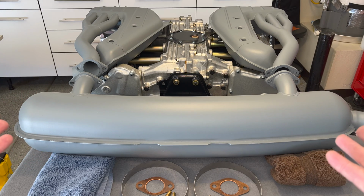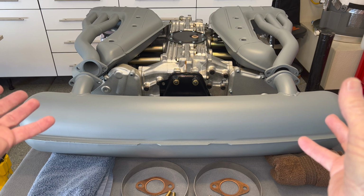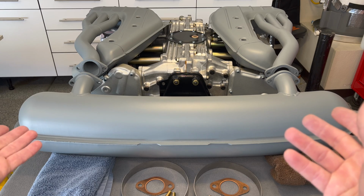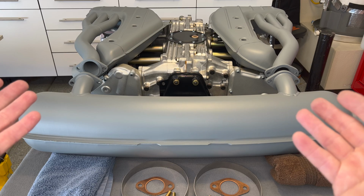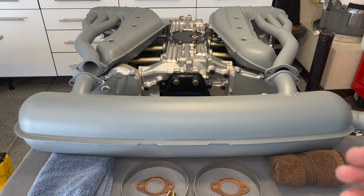So this way we can take the weight, and I can slide up to our exhaust flanges. Being one person, I can just work on one end. The sawhorses can take the other side while I'm working on the other. Once we have everything positioned, all our bolts line up, then we can go ahead and torque things down at that time.